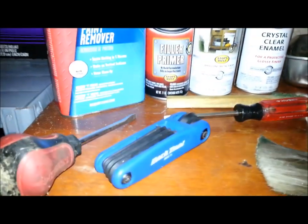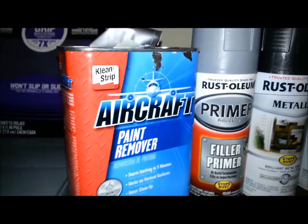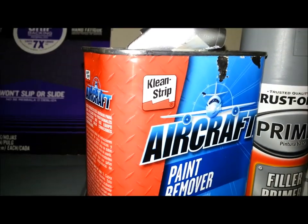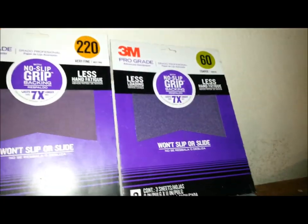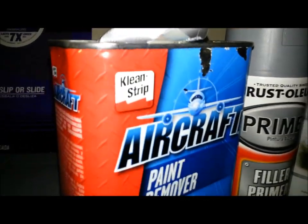Let's go over all the tools and things you'll be needing. Since we are painting the bars, you'll need some Allen keys to take off your bars, and two flatheads to take off your grips. For the painting, you want to pick up some paint stripper. You can just use plain old sandpaper, but I highly recommend paint stripper since it only takes a few minutes and gets everything off nice and clean. I'll be using the paint strip method. The only sandpapers I really have are 60 grit, 220, and 400 — my personal favorites whenever I'm painting anything.